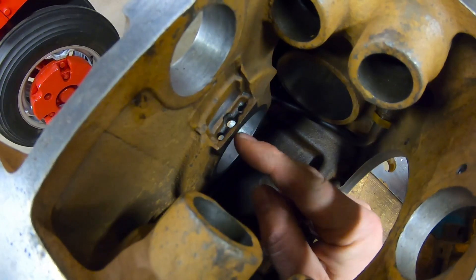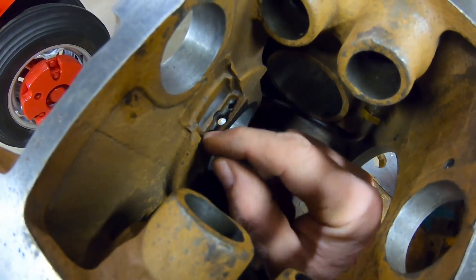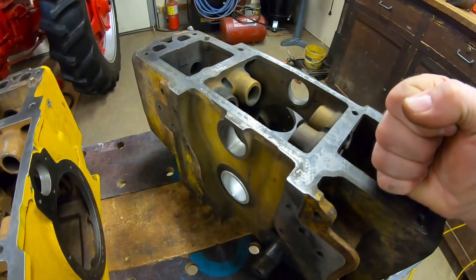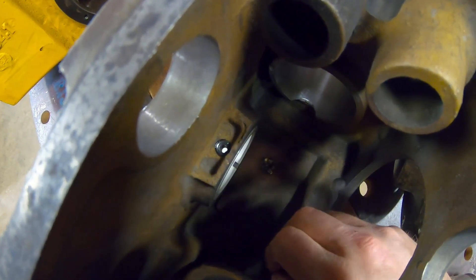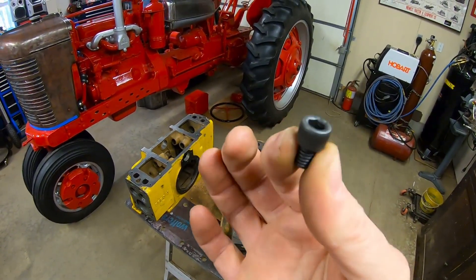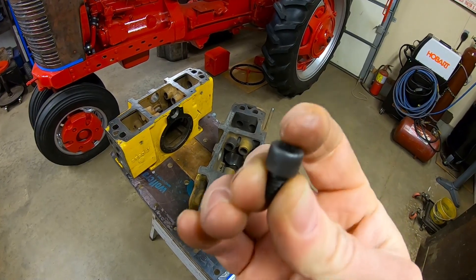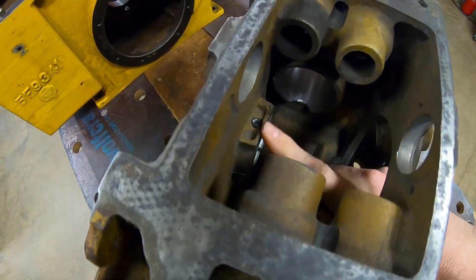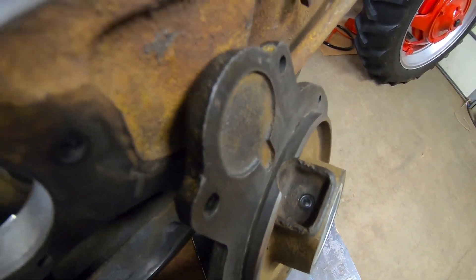By contrast, this is the much more common D2/D4 starting engine block — you can see the large oil seal area on that front main. There's another fundamental difference that tripped me up: on the later block we've got the center hole for the retention dowel or threaded version, plus two other oil feed holes on either side that let oil accumulate into the pocket and run through into the main bearing. This early style block — earliest of the early, no seal — only ever had just the dowel pin hole drilled into the bottom of that pocket; the other two oil feed holes are not there.